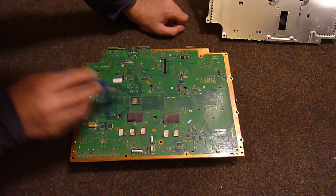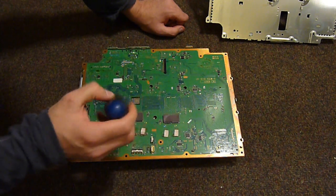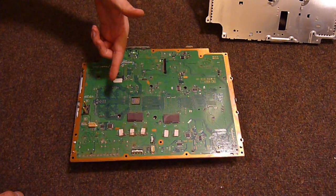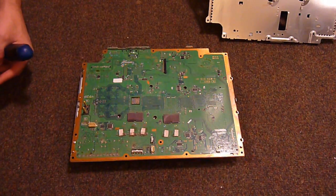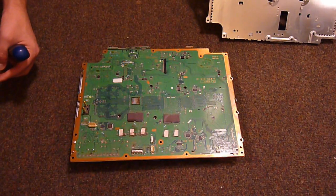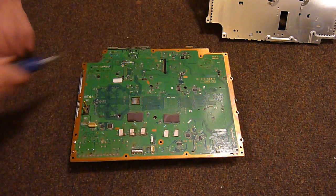If you look, you'll notice that the differential pairs are all in various configurations. The reason why they're often bent in curly-whirly positions like this is so all the traces match the same length, otherwise you risk the traces acting a bit like delay line memory. At these frequencies you can end up with critical bits of data that need to be there within a microsecond, and they're just not, because the wire's acting as delay line memory. So there's a heck of a lot of PCB engineering that goes into designing a board like this.